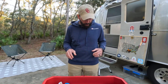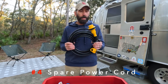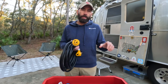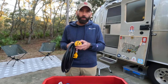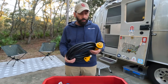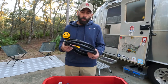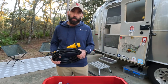Moving on to number four — I keep a spare 30 amp power cable on hand. It's not uncommon when you go to some of these RV parks that their power source isn't necessarily optimal for your rig. You get some voltage fluctuations, and if you're not careful you can end up burning up one of these cables. Or, unfortunately not happened to me, but I've heard of people forgetting to disconnect their cable and then trying to drive off and ripping the head off or something else. Not too expensive, but I keep a spare 30 amp power cord on hand as well.